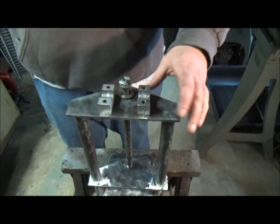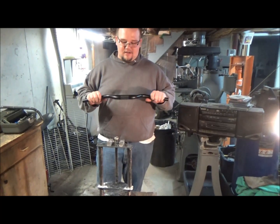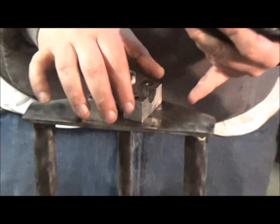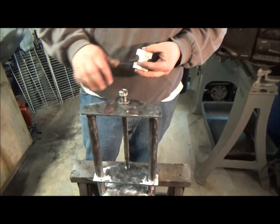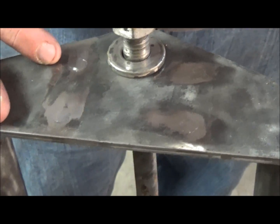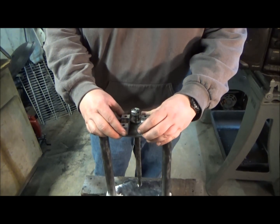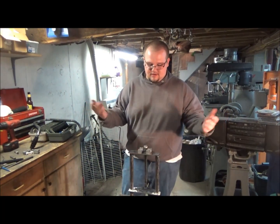That's not going to work for me. I decided to go with these handlebars — they're a lot lower profile, smaller, lighter, and they have a less drastic curve. So what we have to do is move these mounting blocks in. What we did so far is filled the old holes with weld. We'll actually go over how we did that at some point, but we forgot to record it. Right now we're going to put these up, drill some new holes, and hopefully get the handlebars mounted so you guys can see what it looks like as a final product.